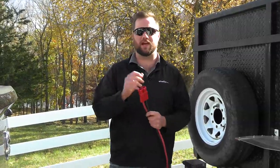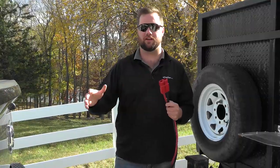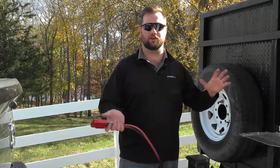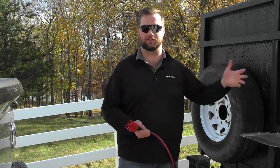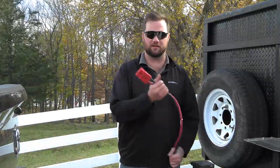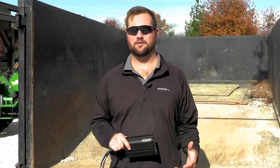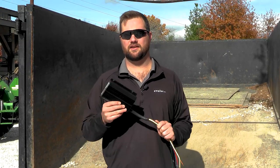It's going to limit the voltage drop because we've increased the gauge of the wire. One of the biggest reasons people add an Anderson plug is because their truck just cannot keep up because of that voltage drop. Another big reason is if you already have other trailers with accessories — maybe a toy hauler for side-by-sides that also has an onboard battery for its jack system. This is really nice because you can buy the accessories that go with this and add Anderson wiring to all your other trailers. So if you find yourself needing more power than your vehicle can provide, you're going to need to look into getting a DC-to-DC charger.